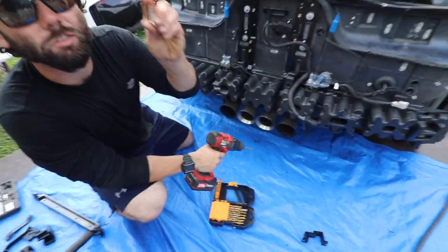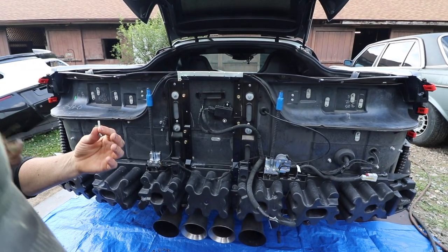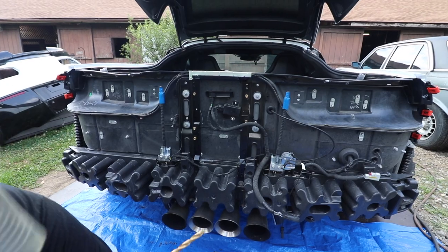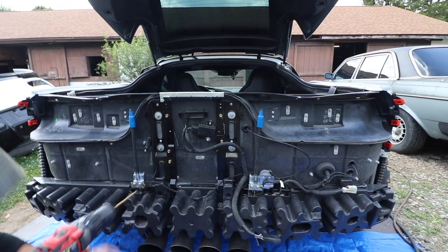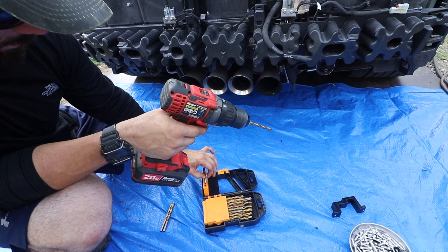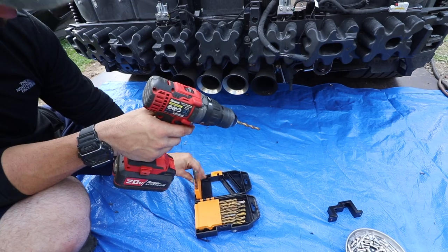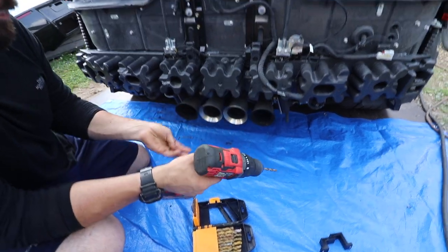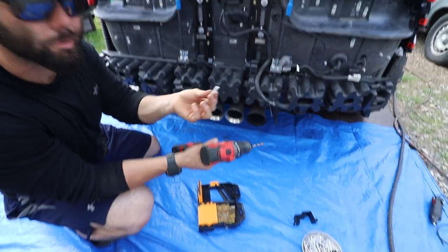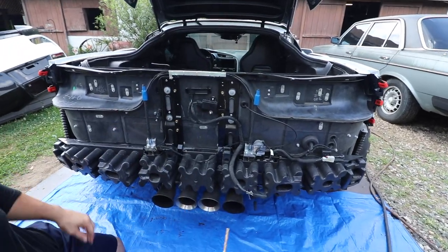There's only two of these long bolts in the entire kit. There's a bolt, and there's a nut to go on the other end, I'm pretty sure. Quarter inch drill bit. So we're gonna drill right through there on both sides where we pulled it up from. Third one in, drop it in, fits snug, good. That's how you know. Obviously, quarter inch is the size you wanna use, but that's just confirming. Trust but verify if you're about to drill a hole in your $100,000 vehicle.